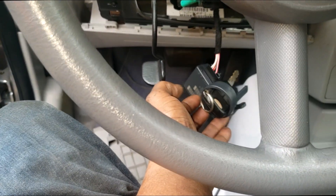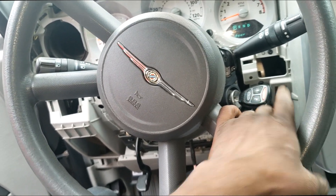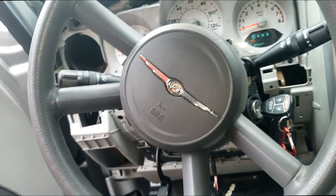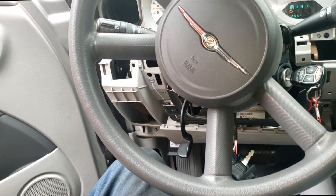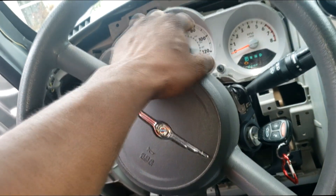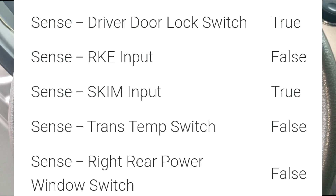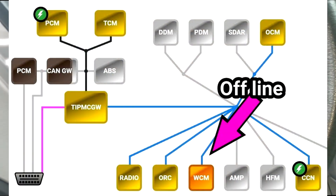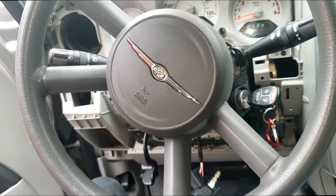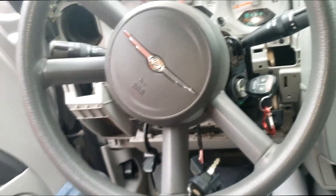As you can see, I've got my spare skim and key plugged in. I tried to do a hard reset on the battery, got the key in to turn the ignition on — that's going to activate the ignition switch. But as you can see, the skim is still orange. I can look in the inputs or check the configuration in the cluster — it shows a skim input. When they disabled this RKE, how did they do it electronically? There's nothing physical they could do because they just sent a box and he plugged it in, and everything skim-related got wiped out.